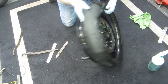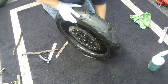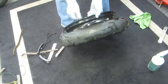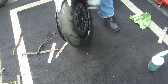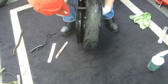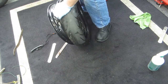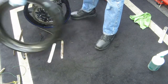That tire will come right off now. You never have too many rim protectors — if you have ten of them, use all ten. From this point, I try the old-school way of just pulling the tire off. Modern sport bike tires are the easiest change of all; the old-school tubed tires are the ones that make you crazy. The tire comes off like magic. Now we'll do a thorough cleaning and figure out how to heat the new tire.